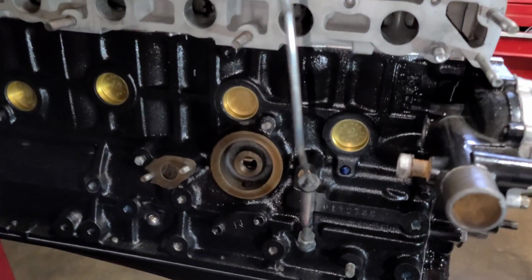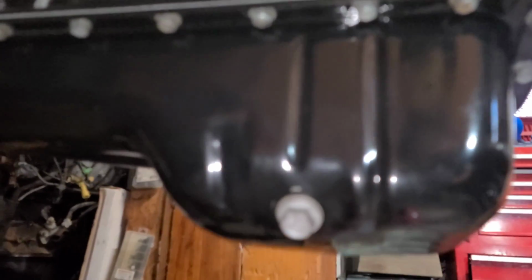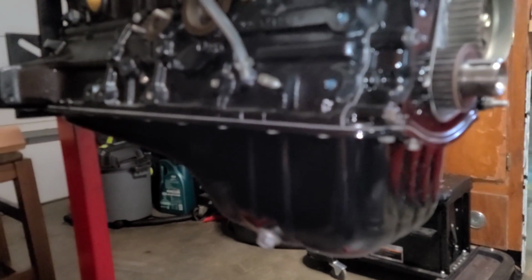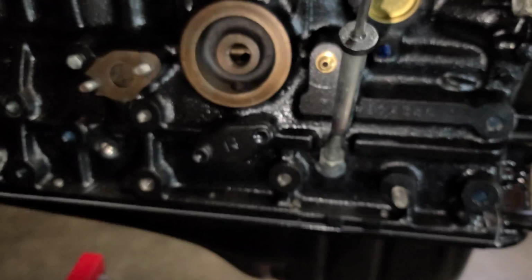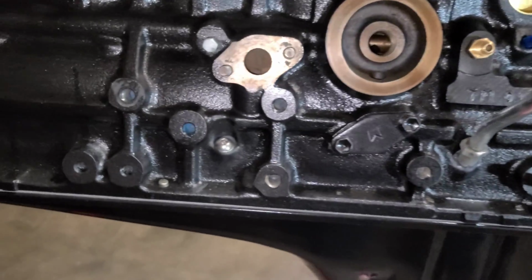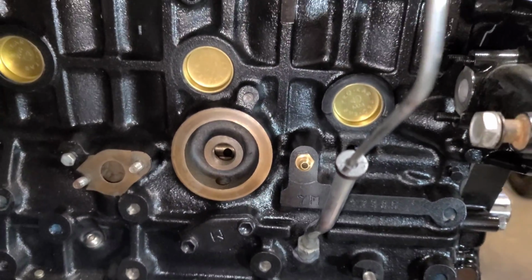Yep, you see we have the front sump oil pan. It's got a little work to it. It's a lot deeper than it originally was, so that we could put the 85 front sump on here. It has bigger gears. It fits really well. And also the dipstick, relocated to the front. Used to be here. That's all sealed up. It's now in its new location here.